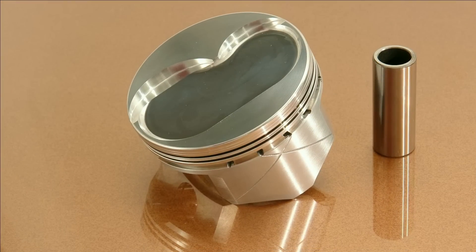A thousand dollars for a totally machined piston to your spec is not very expensive. Here's a piston DSS made for me for a turbo small block Ford. Notice the X pattern on the skirt — this is a patented deal for DSS. What it does is essentially pump oil from the bore to the pan, pumping oil out through the drain holes in the ring land going down the bore and out the bottom when it goes up the bore. The ring acts like a sort of poor one-way valve. Does this work? You betcha. I did do a dyno test on a set of pistons that went from no grooves to grooves and there was a slight increase in power. I'll get around to posting that test sometime in the future.